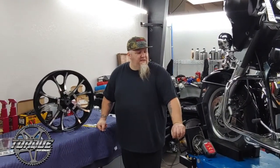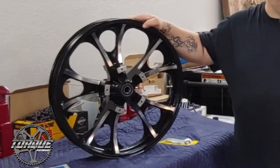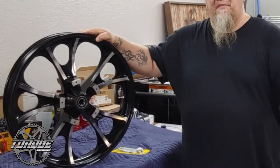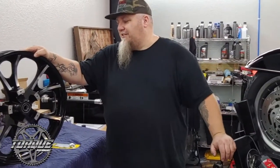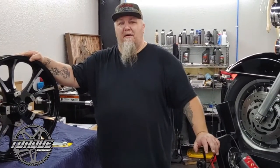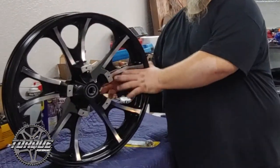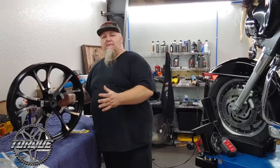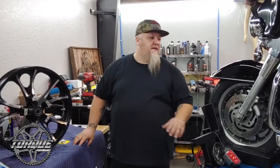This is Paul here with Team Dreamrides, Dreamrides Tennessee. We're going to be going over a couple things today. We're going to be doing a wheel installation on a 2000 FL-HT 21-inch wheel. There are a couple things that tend to run into problems with this installation, so what we're going to do today is the proper mock-up for pre-installation — make sure our brake rotors are going to be aligned with the brake calipers properly, our wheel spacing is going to be proper, and everything's going to be where it needs to be before we install this tire and finish this thing.